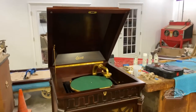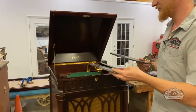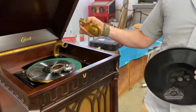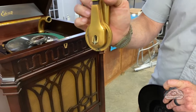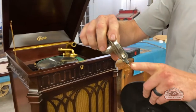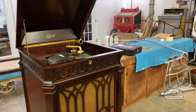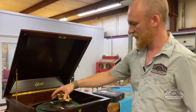There are two basic systems for playing Victrola discs. This is a diamond disc, which plays off a special record that's much thicker and utilizes a diamond stylus on the tone arm. That tiny little nub right there is the needle that actually plays on the disc. That's very different from your regular Victrola that plays on a long steel needle. The steel needle needs to be changed out after every record in order to stay sharp and give you that clean sound. The diamond stylus, on the other hand, can play for many, many revolutions — many records. The estimate is about 10,000 records in the life of one diamond stylus.